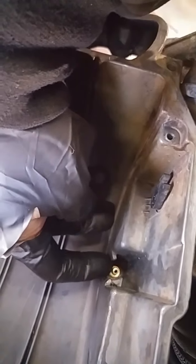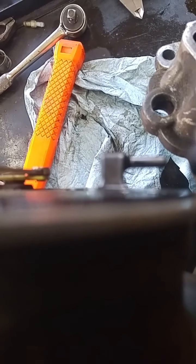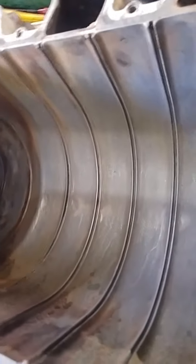My next project now is to measure from the top of my brass nipple there, because it sticks up a little bit, to the edge of my shoulder right here, or slightly down. I don't have to go all the way up to the edge. The last thing I want to do is put a bunch of pressure on this when I'm tightening this thing down. There's nowhere for this thing to go anyway, because there's only an 1/8 of an inch gap between this and the tube that comes up to it, so I just need to make sure I'm shorter. So pretty much I could just measure the length of this nipple and the length of my nipple sticking out inside of here, and add a little 1/16 for luck, and that should be good.